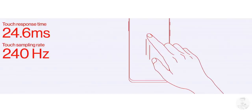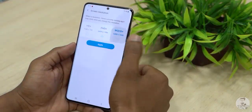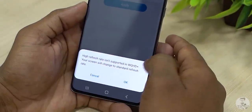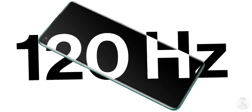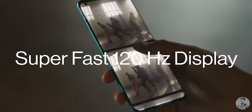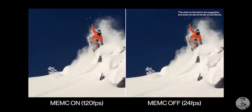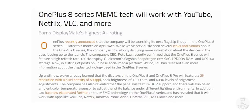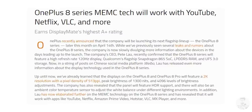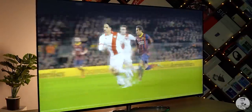The icing on the cake is the refresh rate — the OnePlus 8 Pro can go up to 120Hz at QHD+, with a 240Hz touch sampling rate. We've seen the S20 series sport QHD panels and 120Hz, but Samsung disabled 120Hz at the highest resolution over battery concerns. OnePlus lets you crank it all the way to 120Hz even at the highest resolution. OnePlus has also included a dedicated MEMC chip on the 8 Pro, which takes content shot at 24 or 30fps and interpolates frames to artificially inflate the frame rate, supporting apps like Netflix, YouTube, and VLC Media Player.